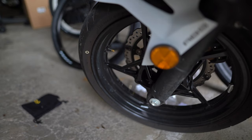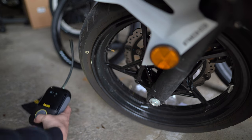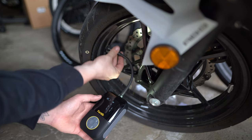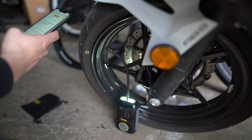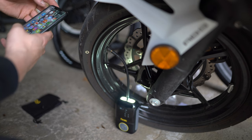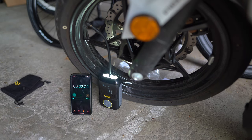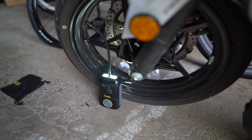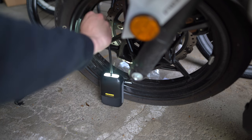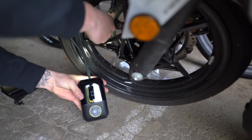28 PSI - it's not much less. That's 1.9 bar. I'm going to set this to 1.9. On this one we were at 1.1 bar, which is 15 PSI. So we were also about half on this one as well. There you have it - just under a minute to top this off. That was from 15 PSI to 28 PSI, and we're still at 2 bars for battery life.